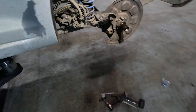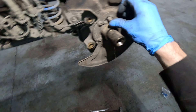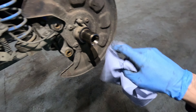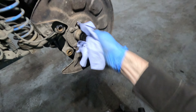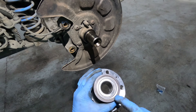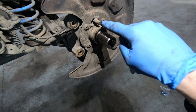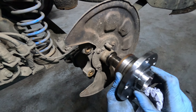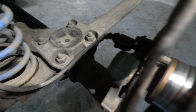Before refitting the new bearing, make sure all this dirt and grime is cleaned off, and make sure the sensor is clean — grab yourself an old rag or some tissue. If the bearing ever gets stuck on there, you can lightly sand down this area with sandpaper just so it seats on there nicely. One tip as well — make sure when you unbox the new bearing, this reluctor ring is not damaged, because that gives the ABS reading on that sensor. Once it's slotted over, you can see the gap between the reluctor ring and the sensor.